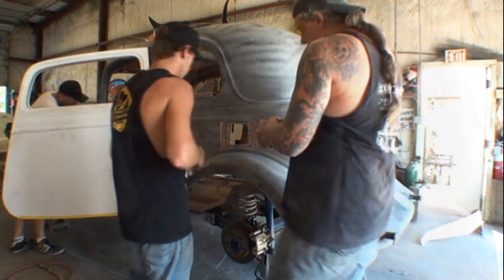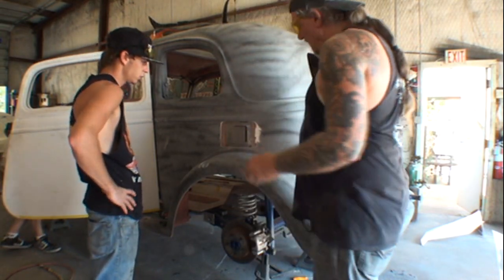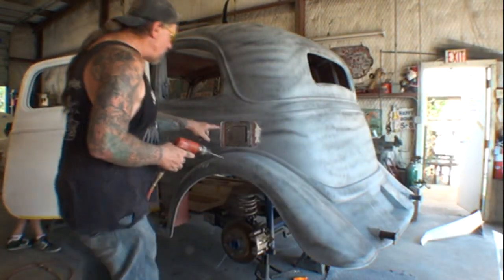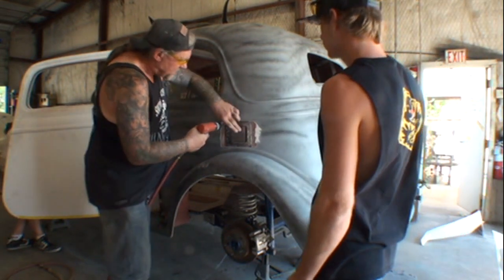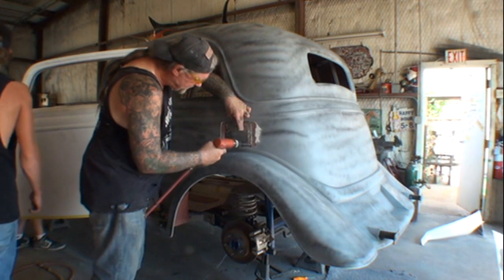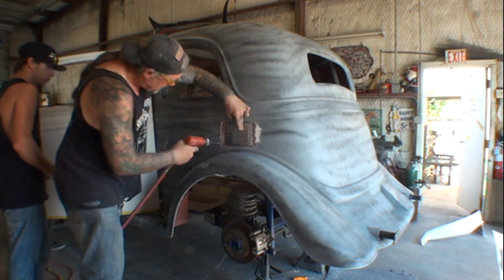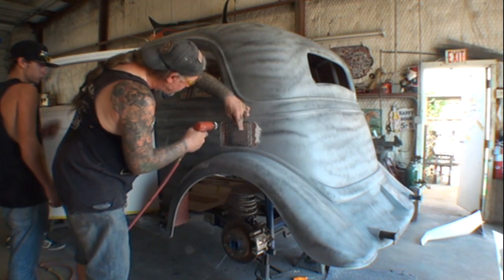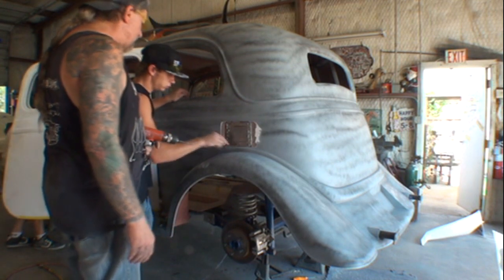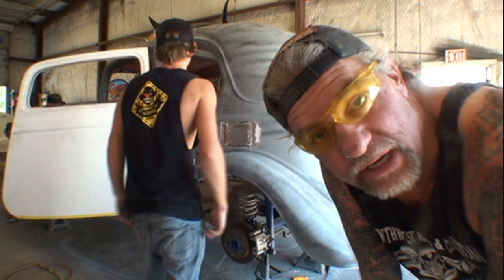Keep going. So we're gonna stick our door in the hole, and then we're gonna push on that door like that. Now, you got your rivets. Get your 4 rivets. In each corner I have drilled out a 1/4 inch hole. So what we're gonna do is pop rivet each corner in. And then once we do that, we'll let that sit overnight with the glue. We'll come back, grind everything down, then fiberglass it in. There you go, get that in there. All right, good job. And you see the situation we got. 10-day build job, working our asses off, getting her done.